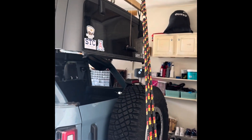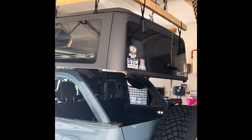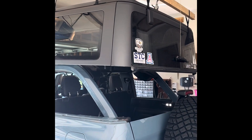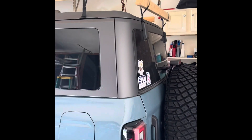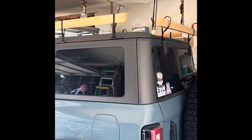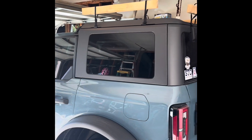Lined up and ready to go — ready to lower the roof down. As you can see I am holding this with one hand; it's not stressful at all. The three-pulley system takes a lot of the weight off the roof, so we're just going to start slowly lowering the roof down. We're going to make sure that everything lines up properly — just give it a little help and there it is. Everything's in place. From here you can disconnect the latches from around the sides and the back, pull the pulley system back up to the ceiling, secure it to your anchor point on the wall, and you're ready to drive your Bronco out of the garage and reattach the bolts and the other roof segments.